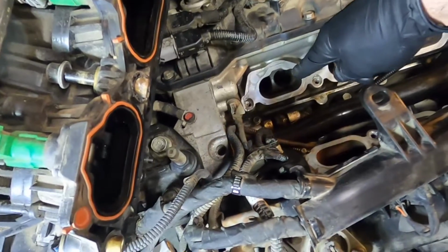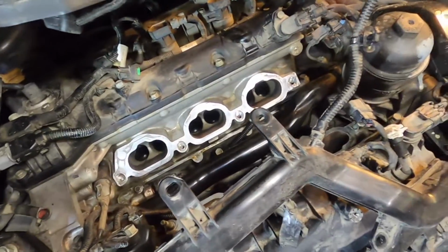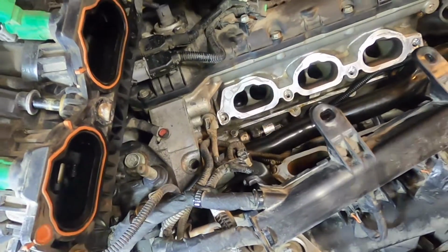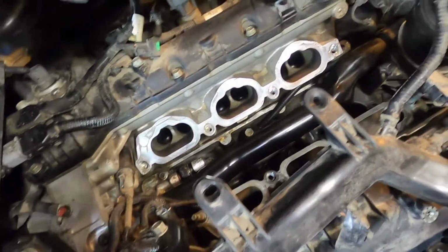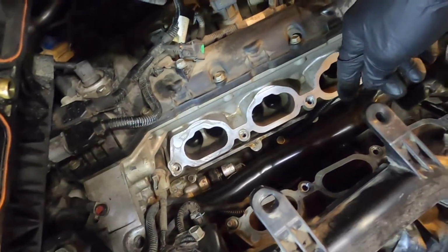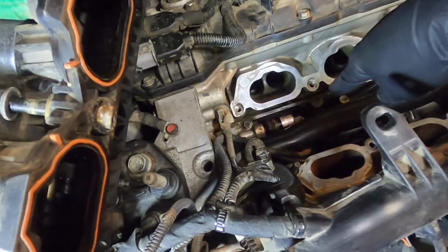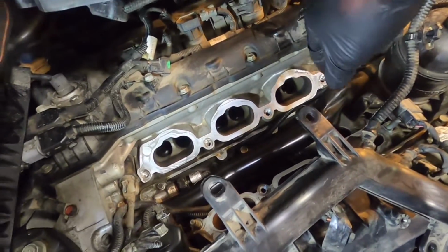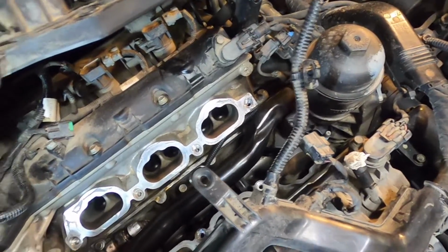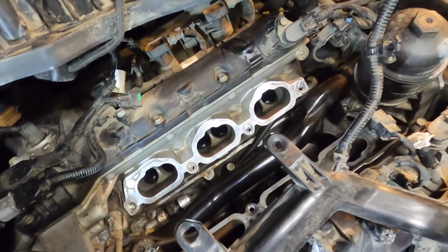And then the last step was to go through, and I actually sucked the paper towels back out of there with the vacuum, and then stuck the crevice tool down in there and sucked in there to make sure no dirt was left in there around the valves. And I also cleared all these holes with an air gun, and maybe a little controversial, but I did put a drop of oil down each one as well, so they'll be lubricated. And yes, the torque specs are probably for a dry torque, so you might want to reduce the torque spec a little if you're also putting oil there.